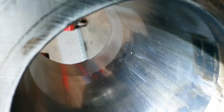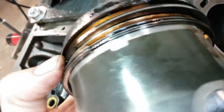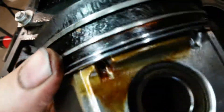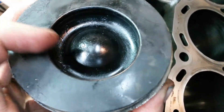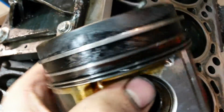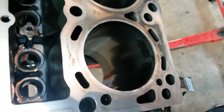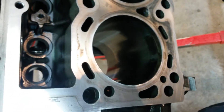So it was a ring failure. The engine had blow-by its whole lifetime, and then it was up in Canada and it just completely blew. Here is the actual number seven piston — the center ring actually seized up in there. Despite the burnt oil, it actually doesn't look all that bad. But this ring apparently seized up and just started cutting away at the cylinder wall, and with the 40-over block it had way too much flex in the cylinder wall.